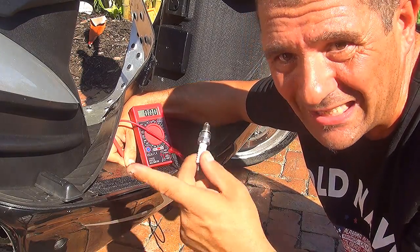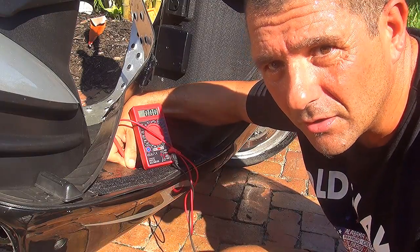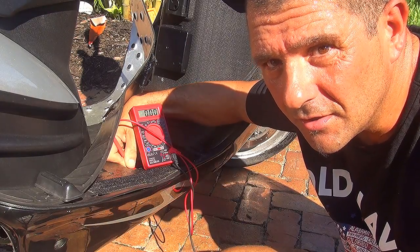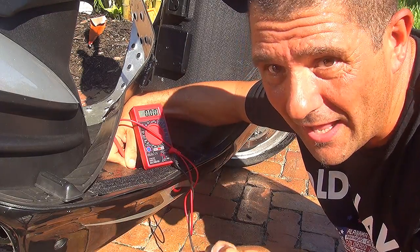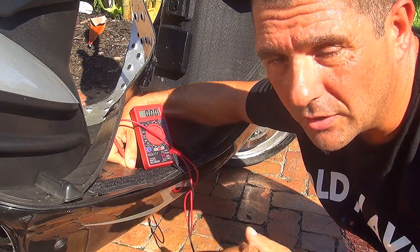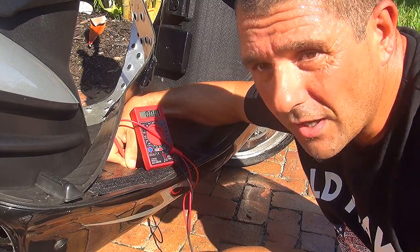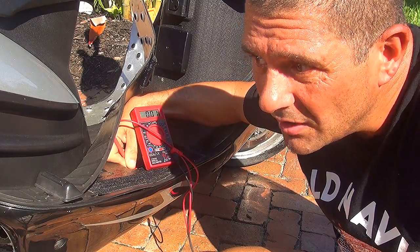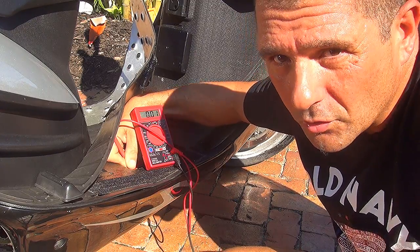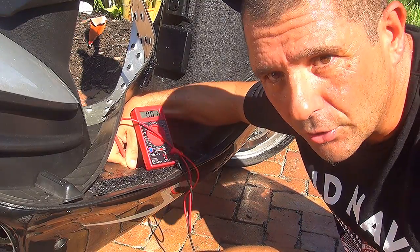Also remember, your stator — your bobina — is working on the ground. I understand it's producing positive current, but the base of that is having the ground on the motor. So it's having the ground on the motor that is producing positive current to the scooter. So if you don't have a good ground, you're not producing great current and may not recharge the battery the right way or not enough. That could be one of the solutions or problems that you could have.